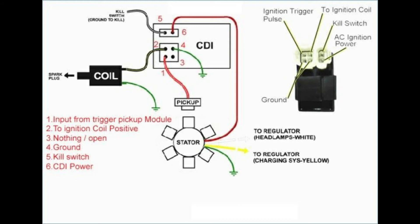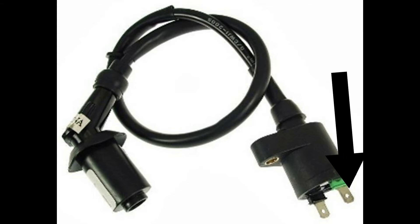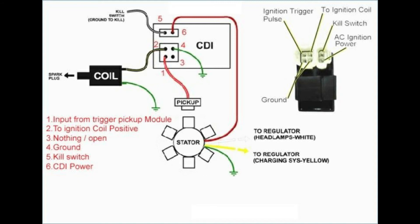Crank the engine and use your multimeter to check for voltage at the two primary wires of the ignition coil. Connect the black multimeter lead to the black ground wire at the coil, and the red lead to the lighter color wire — usually blue or purple, but this will vary depending on your engine model. At this step, we're checking exactly what the CDI is outputting. Write these voltages down. From my years of experience working on small engines, the CDI is a very common cause of no spark. I'd say about 50% of the time, replacing the CDI is going to solve your no spark problem.